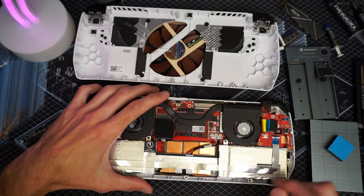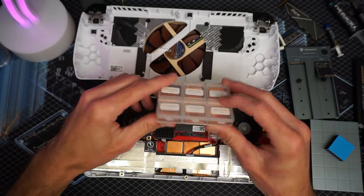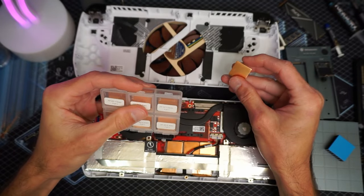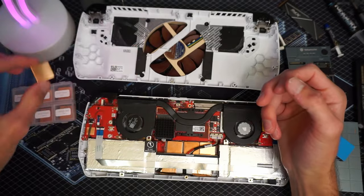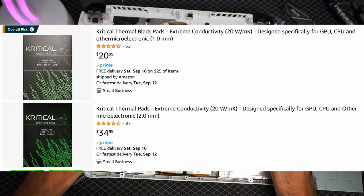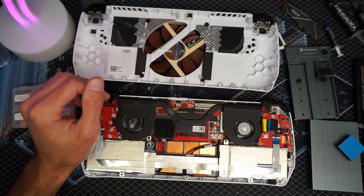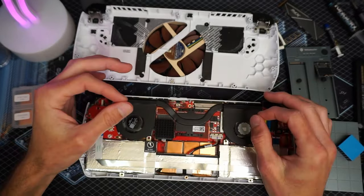This right here is some copper one-millimeter slugs — little copper shims. These are little copper shim kits you can buy on Amazon, they're not that expensive. These might actually be 1.5 millimeter. So it's basically a little copper slug underneath the drive. I've also got some pads called Critical Pads — they're very expensive and I don't think they're worth it. But if you want to try them, by all means. I had a spare set from my GPU water block days with EVGA cards. They're amazing but like clay — very thick, clumpy, and mushy, but very sticky, and I like that.